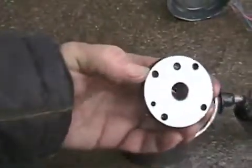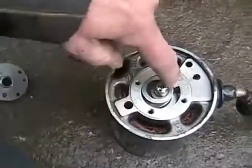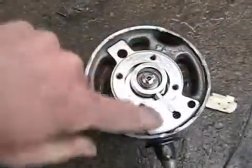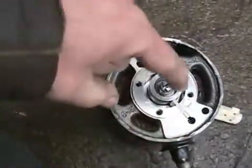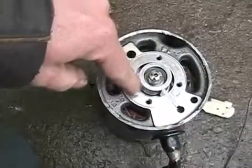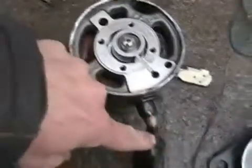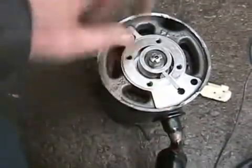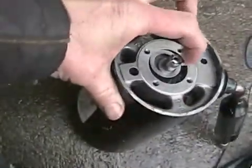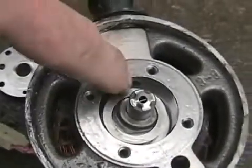You have a precision-machined hardened steel plate, like a circle, and a spring-loaded vane — you can see the spring there. When this thing moves around, it's on an eccentric, and the gap changes, shoving freon out one hole and sucking freon or gas in through this hole. You can see the hole there, and that side of that little cylinder — now you can even see it better.